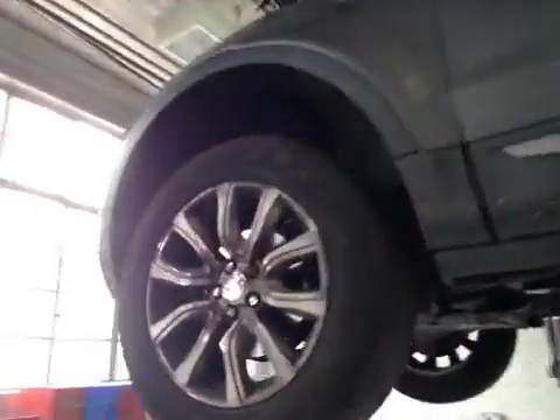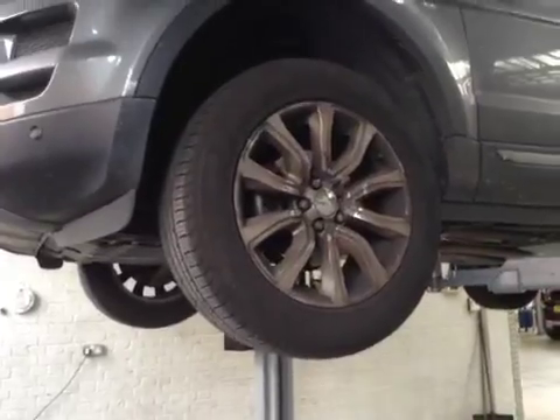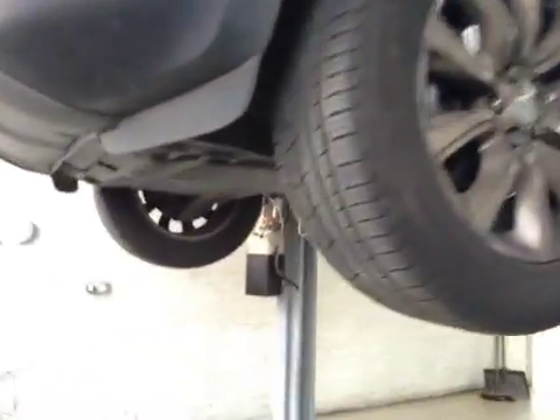All trims and mouldings on this side of the vehicle are in good condition. Coming to your passenger side front tyre, you've got 6.2mm of tread on this tyre. No cuts to the sidewalls, no exposed cords. Front discs and pads are in good condition.